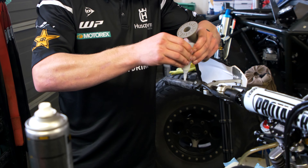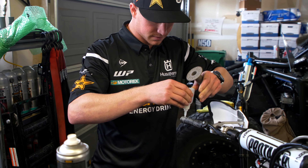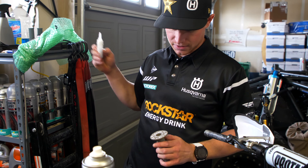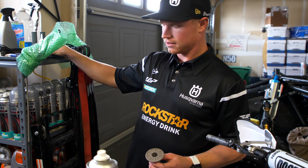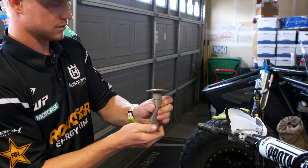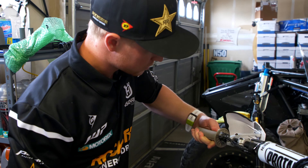Alright, start the process. Throw a generous amount of glue — you want to get it at the end of the bar to seal that. I throw a decent amount. The less you use, the faster it's going to seal, so just a heads up. Throw a little bit on the inside of the grip too — I just like to do that. A little bit of brake cleaner. Make sure it rolls around. Get it on there; you can dump the excess on the bar.